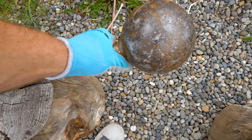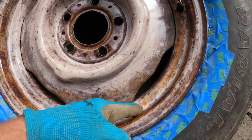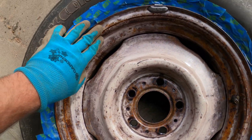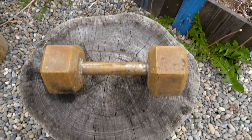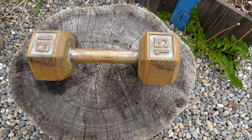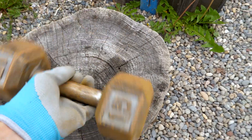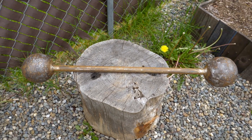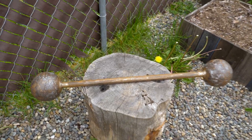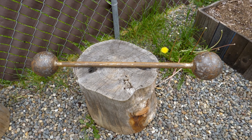With this weight in front of me, it had some old paint on it — mostly rusty, but with some glossy paint. The rust converter doesn't do a great job on paint; it's not going to adhere to glossy paint, though it will seal it since this stuff also acts as a primer. So if you have mixed surfaces with rust and old paint, I recommend going over that with some 80-grit sandpaper — basically taking off the shine and making it matte. Then clean off any paint dust before applying the rust converter. Your ultimate goal is to get the surface to have a smooth layer of tightly adhering rust.